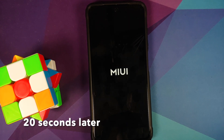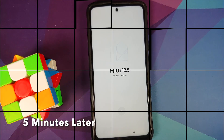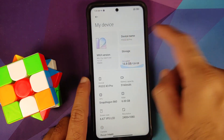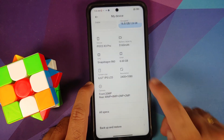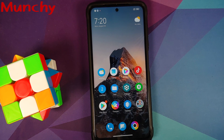Tap Reboot System — and there it is, we have the MIUI boot animation on the Poco X3 Pro, which means we are booting into the Xiaomi EU ROM. The first boot might take some time, so be patient. We are now on the setup screen. Skipping the initial setup — we're on the home screen. Going into Settings, My Device: MIUI version is 12.5.3 stable by Xiaomi EU, Android 11, device is Poco X3 Pro. That's how you install Xiaomi EU on the Poco X3 Pro — hope this helped, likes, shares and subscribes are appreciated!